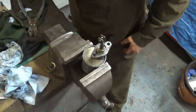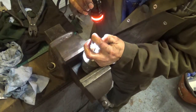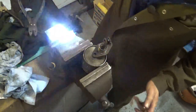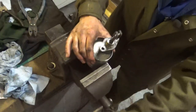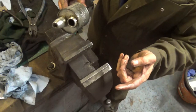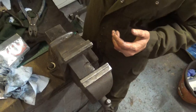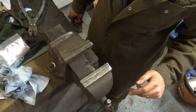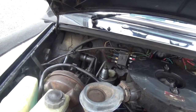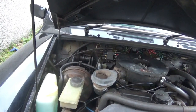That silver clip has snapped into position — that went in relatively easy. Now to get this refitted back onto the car, but before I do that I'll need to clean up the area around it and I do have a new gasket for it as well. So I'll go and do that off camera. That's everything back together now — the clutch master cylinder's in, I've cleaned up all around it and it's bled, so it's working and topped up. Hopefully that little problem is sorted.